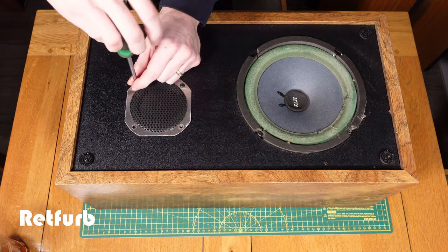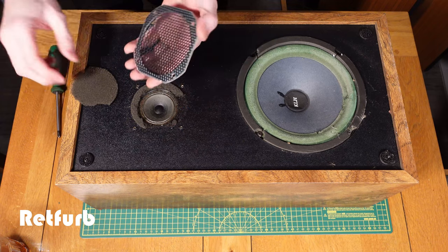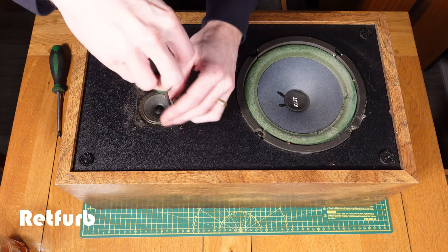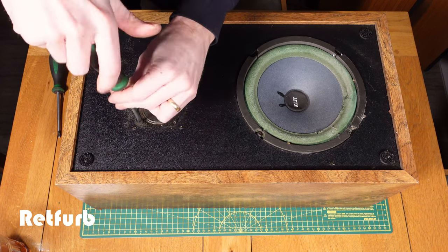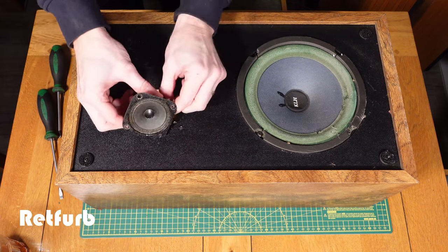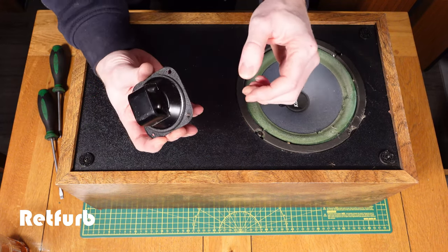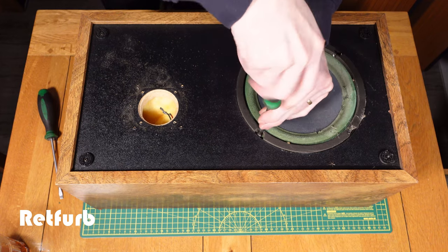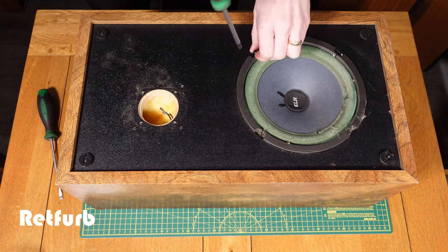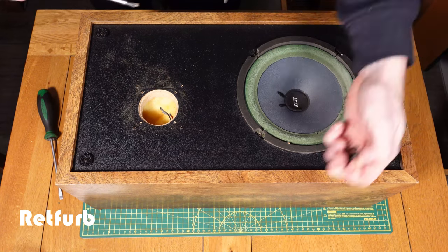The first thing we need to do is remove the speakers from the unit. There are four screws that hold the grille over the small speaker, and then four small screws underneath holding the speaker into the box. The ones that hold the grille are just normal cross heads, and the ones that hold the small tweeter in place are flat head screwdrivers — also a hex head, I think about 8mm. Now on to removing the main speaker — just four cross head screws. Once removed it can be lifted out and the cables removed from the back.